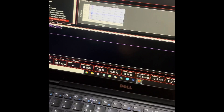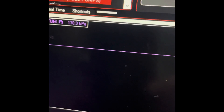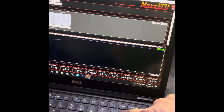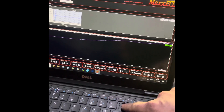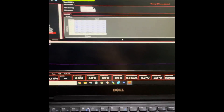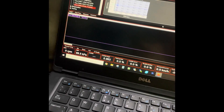First test of the fan controllers. Just got to watch and hopefully fuel pressure goes up. Increase the duty. Oh yeah, getting some fuel pressure there. Let's increase the speed — and some more fuel pressure. Look at that. I noticed there it wasn't pulling a lot of current, and the return wasn't really flowing anything, which has got me kind of confused. And the pressure here didn't raise up much.